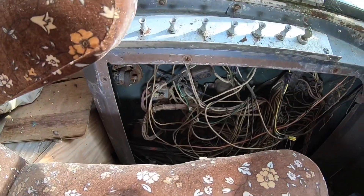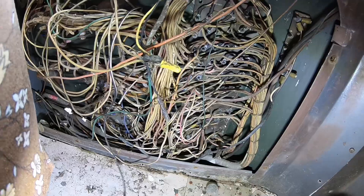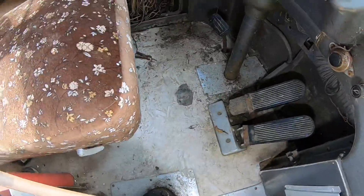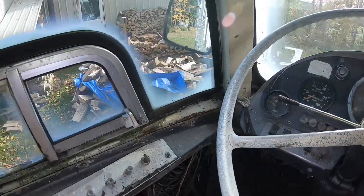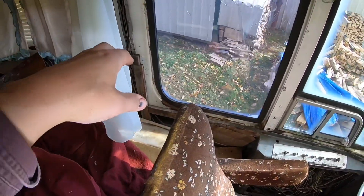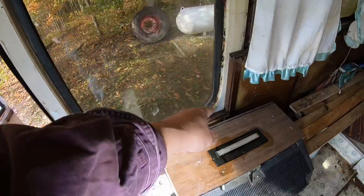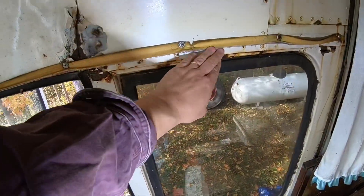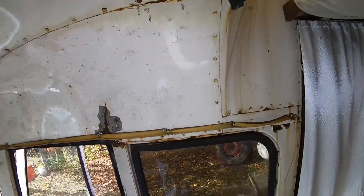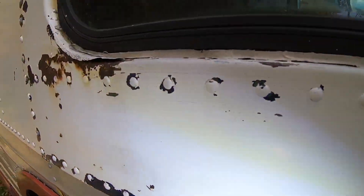This is the original wiring, which I'll be going through completely - none of this will survive. So getting rid of all that. I'm going to build a new loom for the bus. The plywood underneath is pretty rough, the bus has leaked. The majority of the corrosion damage I can see is around this window here at the bottom - rusty. Same deal over here. I don't know if this is common to the Buffaloes, but there's a crack here that looks weldable.